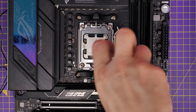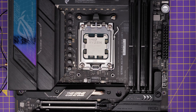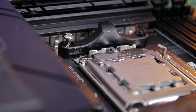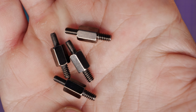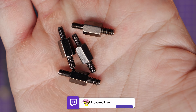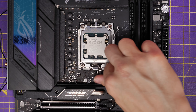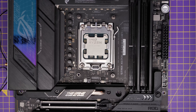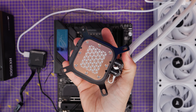That's Intel, but for an AMD AM5 socket motherboard, the first step is to remove the standard standoffs included with the motherboard. Unscrew the four screws at top and bottom holding the plastic clips and remove them. The iCue Link system requires you to use specific standoffs — note that one end is thicker, and you need to make sure the thick end is the one that screws into the motherboard into those four corners, otherwise they'll be loose.